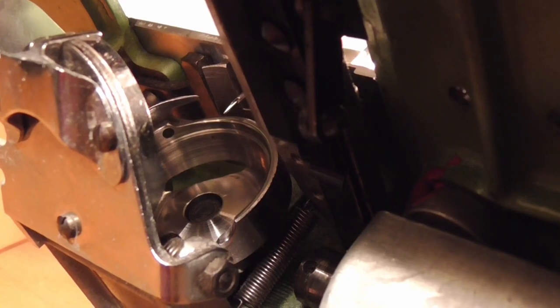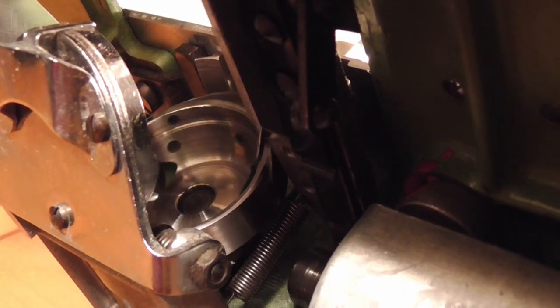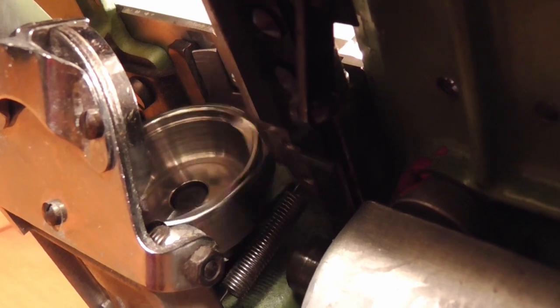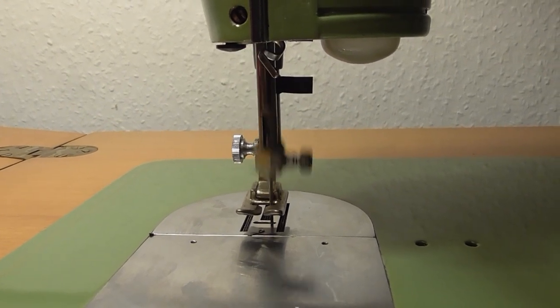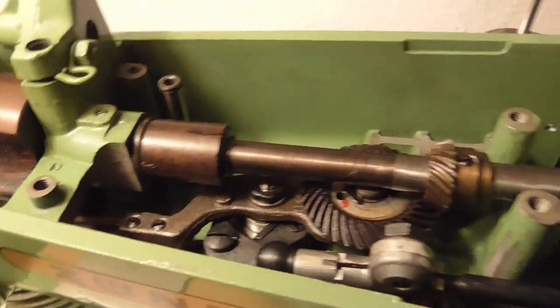By now I've changed the belt on this thing three times and it's really not that difficult once you've got the hang of it. All you need to pay attention to is the timing between the needle and the rotating spool — you don't want the needle to hit the spool, you want it to enter in this fork. The needle step-over needs to be aligned with the needle position too; you want the needle to step over at top dead center, not when it's down or mid-travel. It can be done with a little bit of patience — take care that the gears match properly and have a tiny bit of end play, not too much, not too little. Loosen all the screws, pull the shaft out, put a new belt in — that's it. Once you're used to it, maybe 15 minutes.